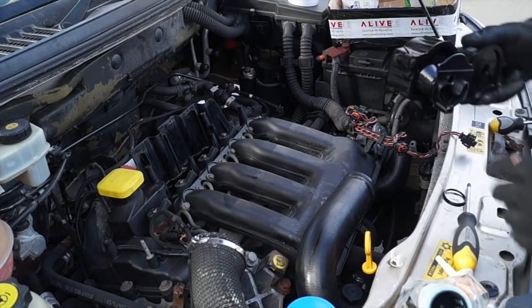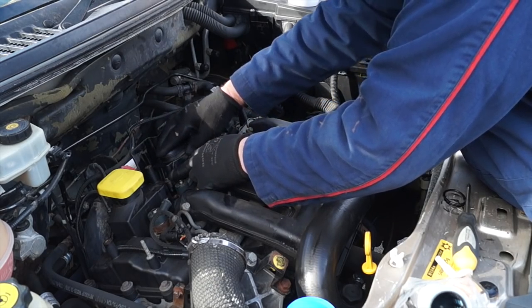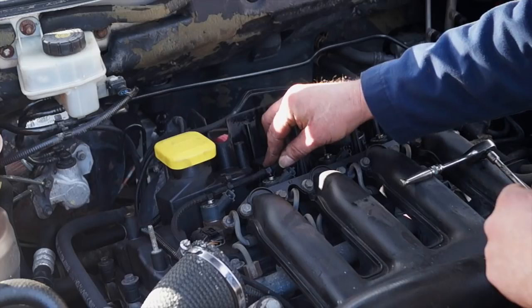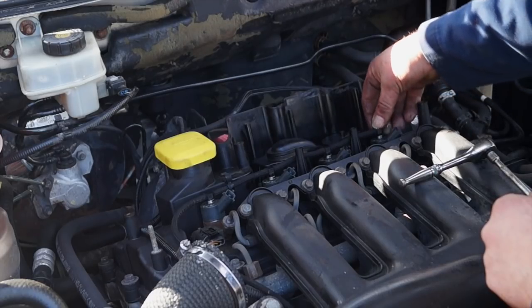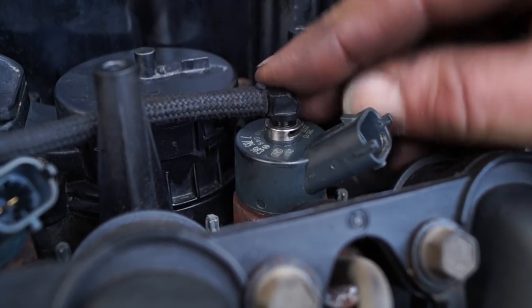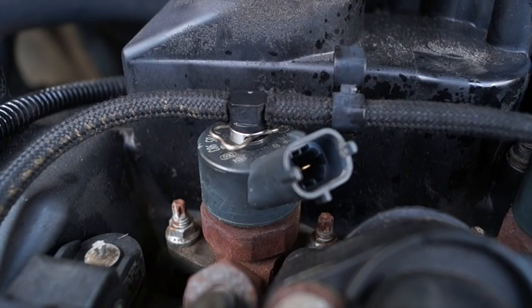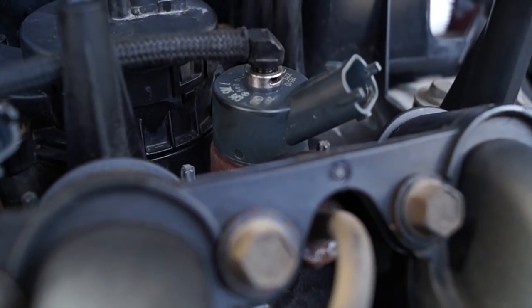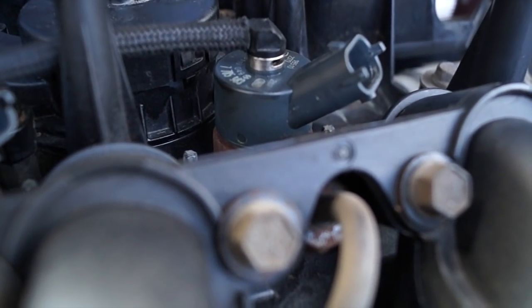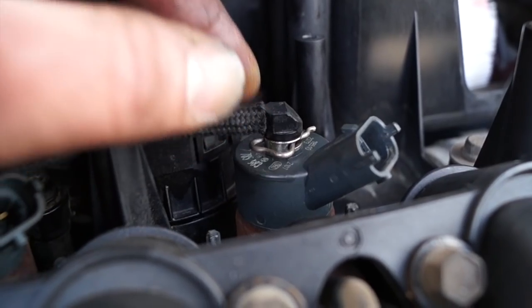Once the gaskets are fitted, then you can go ahead and fit the housing back into place and screw it down. You then will be wanting to fit the injector spill rail back into place. Basically, these pieces are plastic, so you have to be careful with them. When you push them, make sure that they click into place and they're located properly, otherwise they will leak. If it's not fitted properly, the clip which fits in the groove there will not fit. So basically a light tap with a screwdriver handle will do the job, but just be careful with these. Right, so the clip goes in like so, and repeat for all 4 of them.